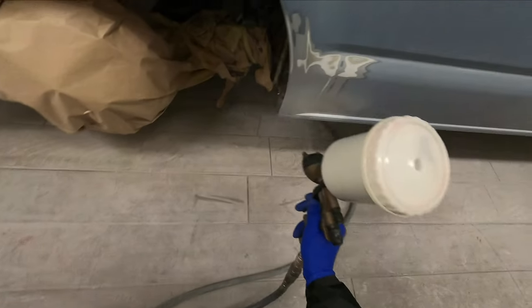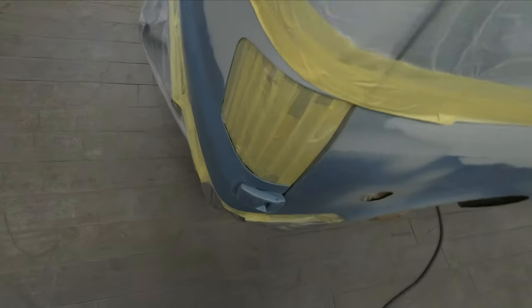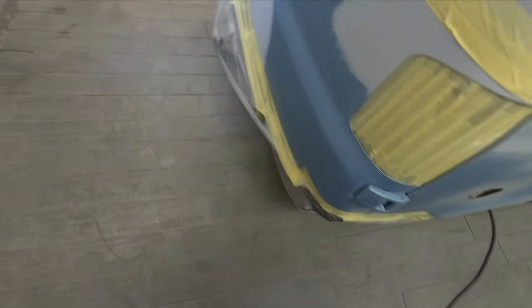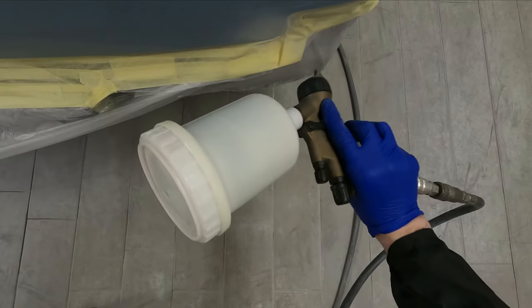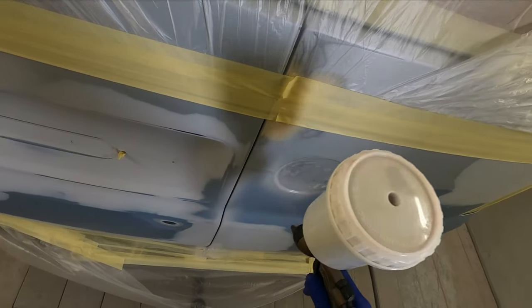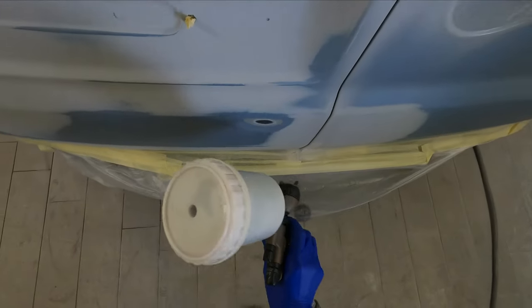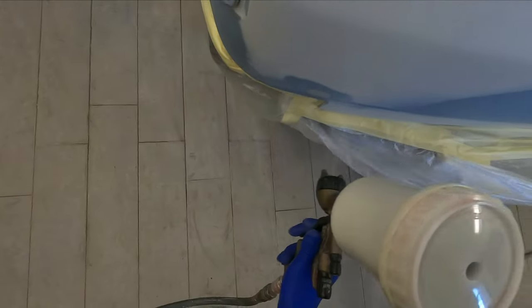What this small fan will enable me to do is keep this quite accurate and only put the primer in the areas that I need it. It'll also lay a very fine film of primer so we're going to get no heavy dry overspray anywhere. We will still tack this off once we've given it around about a 20 to 30 minute flash off time in the booth with the heat running at around 25 to 26 degrees. But if you mix it quite fine like this and it's quite thin and you lay it on with quite a bit of pressure, putting a very small controlled amount on the panel each time, then it'll lay really smooth with very little overspray. The aim for me is to try and do it in one go — you just want that very nice fine layer.